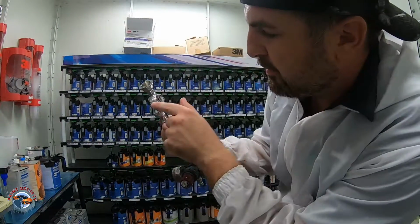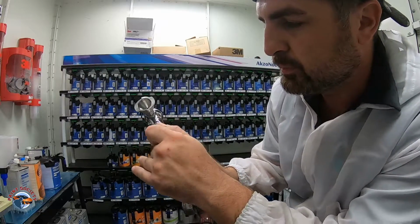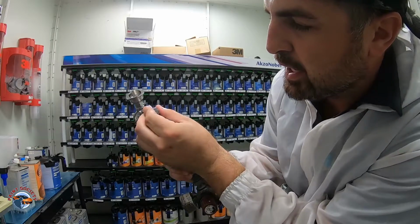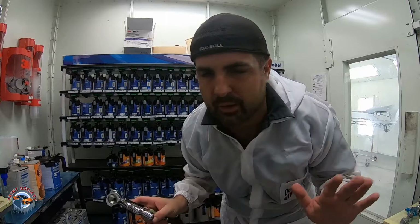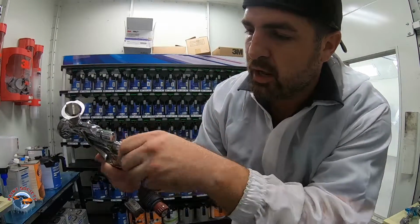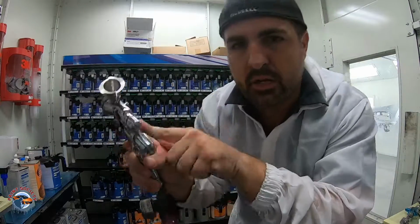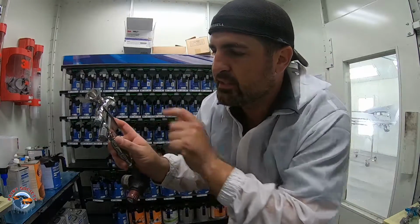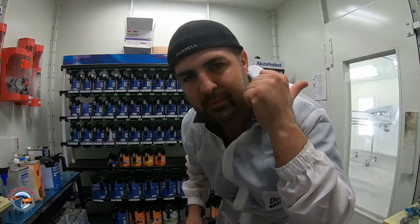Okay. Fan on this, open it all the way up. Okay? 3 turns. 1, 2, 3. This gun performs awful when the fan is open wide. It's too big. Fluid, same deal. Open all the way. Close when you get that resistance right here and I can't turn it anymore. Gonna set it wide open right now, then do 1 more turn. 3 turns in, 1 turn in from wide open. PSI 33. Let's spray some clear.